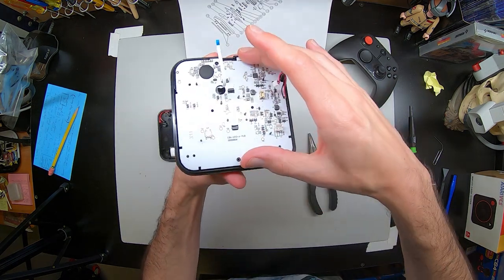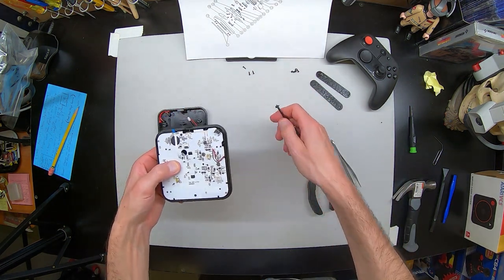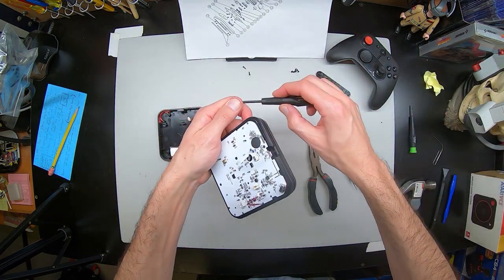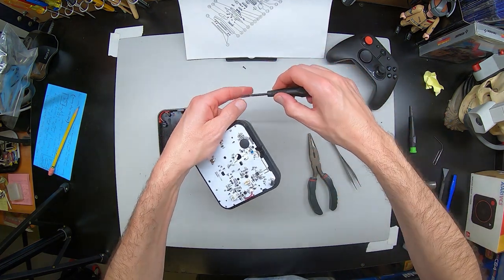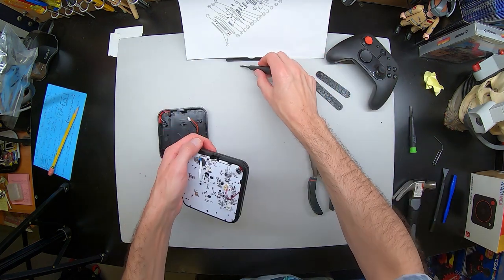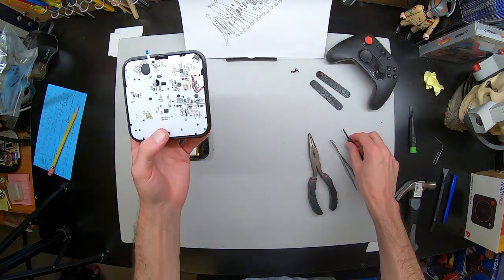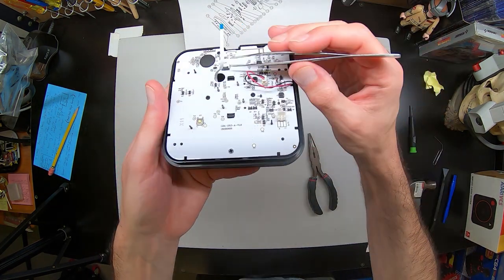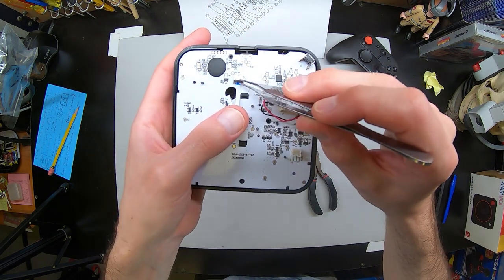There are four again. These are the Phillips head number 0 by 25 — a little thinner head, you will notice. Plastic screws — I always suggest be very careful. I always put a screw down and then reverse until you can feel it jump over the threads. That way I know I'm not cross-threading, because when you cross-thread plastic, you're pretty screwed — literally. Just be careful with plastic screws always. Screw one, two, three, four — there we go. The PCB is all back. We are already over halfway done — it's amazing how fast it went back together. Put in the cord for the rumble motor — I try to make sure the cable is the exact way it was so there's no extra stress on it. Pop up the ribbon cable lock, slide the ribbon cable back in. Because there's a lock, you basically just push it to the back, it's still free, and then you lock it down.